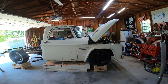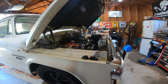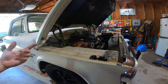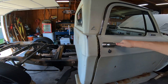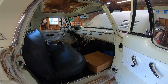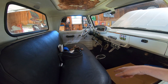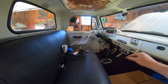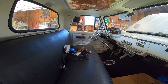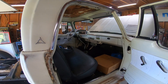This truck is another example — not something everybody's doing, but we can also get the shifter located exactly where you need it. This is a 392-swapped old school Hemi in a '65 Dodge D100, and we used a Tremec TKO for it as well. You may have seen it on Power Tour last year. We used the back shifter location, straight up, and it came out perfectly where we needed it. And if we wanted to move it toward the driver's side, we can use an offset dog bone to move it that way.